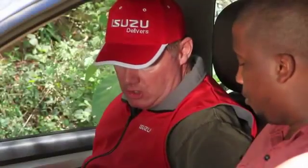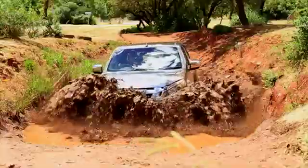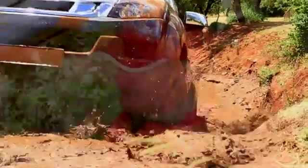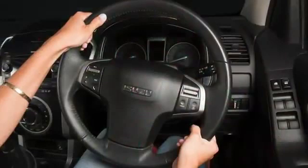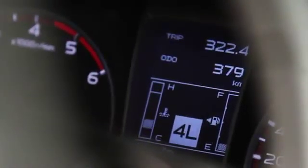The next ratio I have is what we call 4-low. Four-wheel drive, low mobility. It's the most powerful ratio that this vehicle has. That allows me to get maximum torque, maximum power, maximum traction, used for very severe terrain. As a convenience and a safety issue, wherever you are on the dial, whether it's 2H, 4H or 4-low, it will come up right in front of you on the dial.